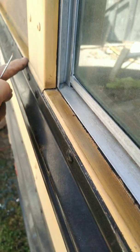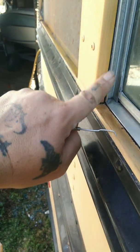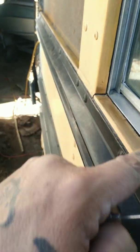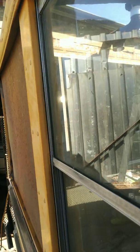And you know, back here, especially over the gap, every seam, all the way down, all the way up into there, small bead. There's like a foam up in here, and when I'm driving, I don't want the water going up and in, so I'm even gonna run a small bead right along this edge of sealant. And like I said, I will figure it out, and I will find out.